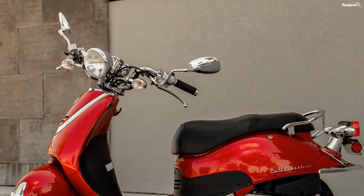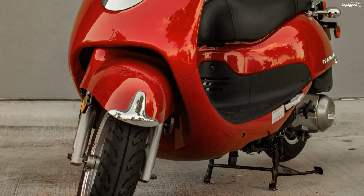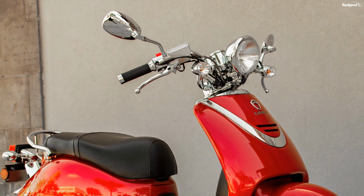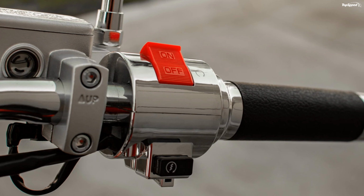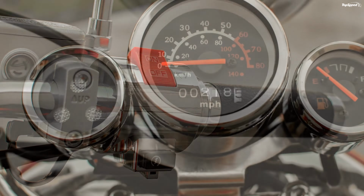Next up the chain we have the 124.6 cc 125. The mid-range engine cranks out 8.38 horsepower and 6.14 pounds of grunt with a compression ratio of 9.6 to 1 and top speed around 59 miles per hour.